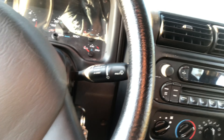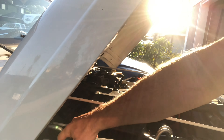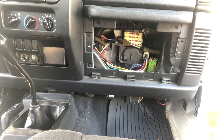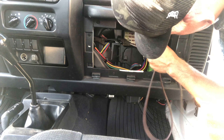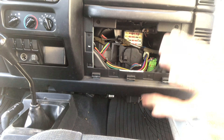There are a lot of good YouTube videos on how to check the fuses, so that's the first place you want to start. On a 2006 Jeep Wrangler you're going to have fuses in this compartment and also inside your glove compartment. With your tester, you turn on the engine so you have power, find a ground, and test all the fuses — the tester will light up to show whether your fuses are good.